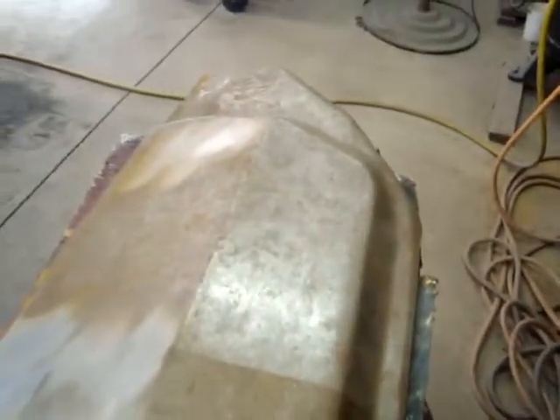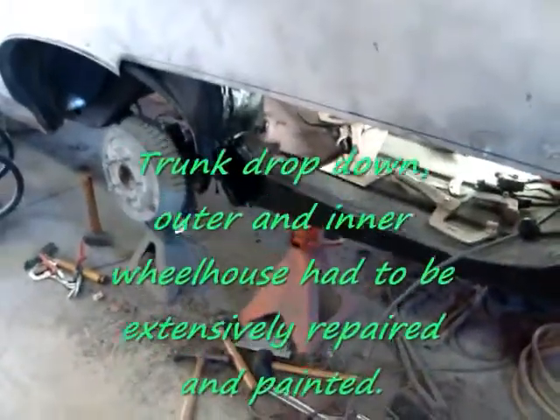You get panels in and they got to be prepped. This must be an older panel — this roller quarter — and it's got some kind of film on it, something sprayed on it to keep it from rusting. There's some rust on it. Got to prep this inside out with all the holes in for our spot welds on the bottom, and we will paint all the inside before we install it. Do the final fit on this, paint it on here on all the lower repair, everything.